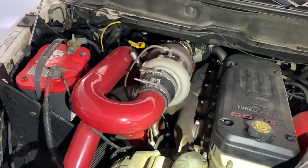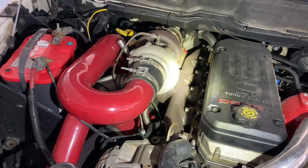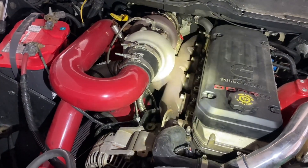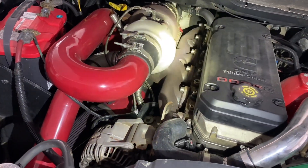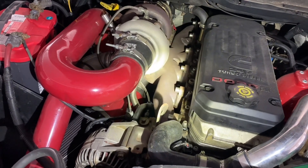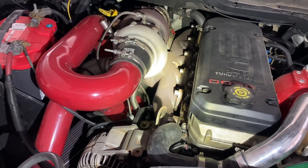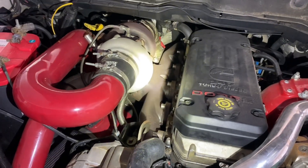So why do a second-generation swap? This is a performance exhaust manifold with larger diameter and better flow, and there are quite a few compound turbo kits that require the second-gen swap, giving you more options. The reason I went with this is because when my factory injectors went bad, I put 100% over-sized injectors in this truck for a performance build. With more fuel you need better exhaust evacuation and upgraded air.